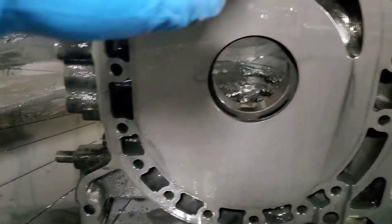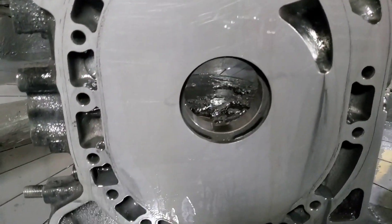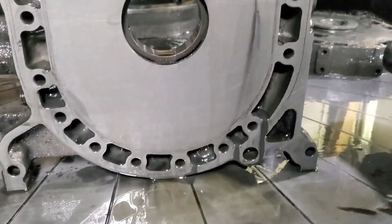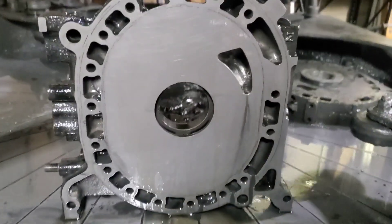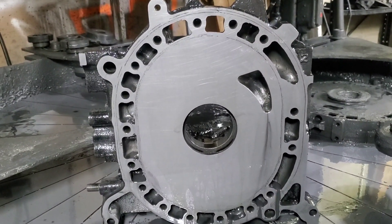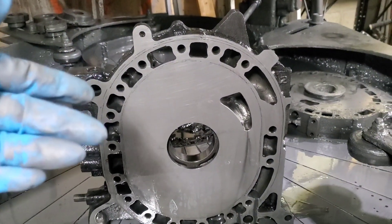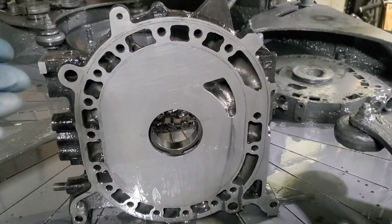As far as our water O-ring seals, there is a little bit of pock marks — this is an older housing so it does have a little bit of porosity — but there's plenty of sealable material for the metal-to-metal seal and that O-ring to ride on. So this housing's going in the sonic tank next. I wanted to call this one a wrap. That's what lapping is about: taking old rotary parts and making them not only usable, but the best form of usable that they can be.